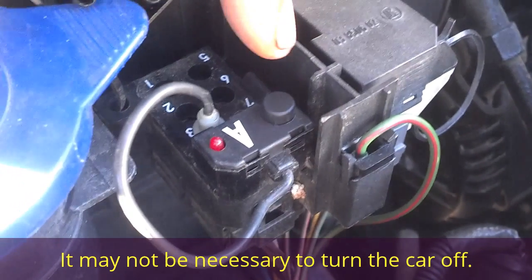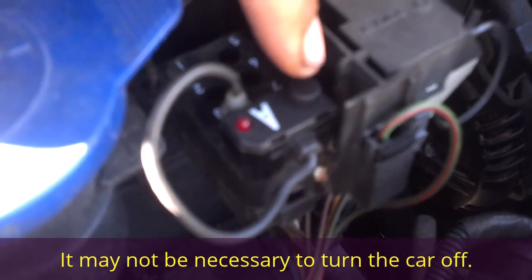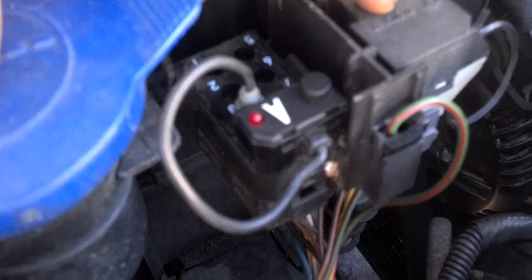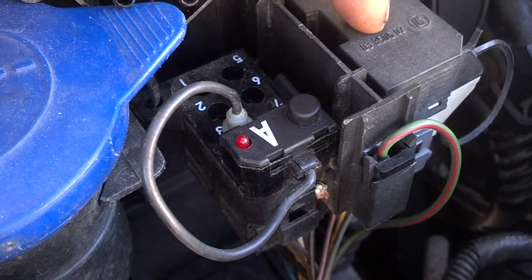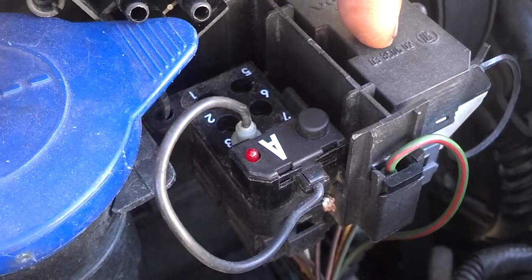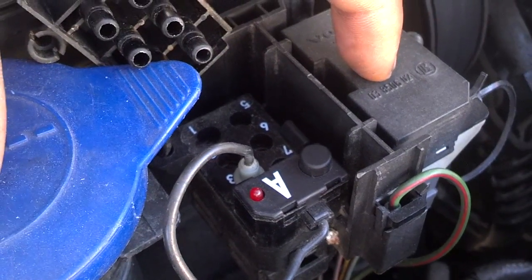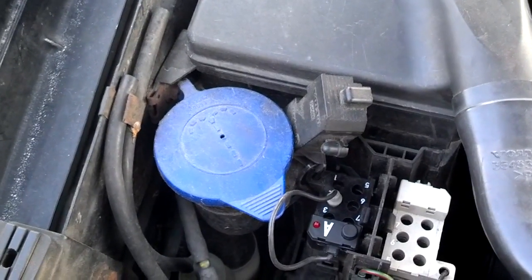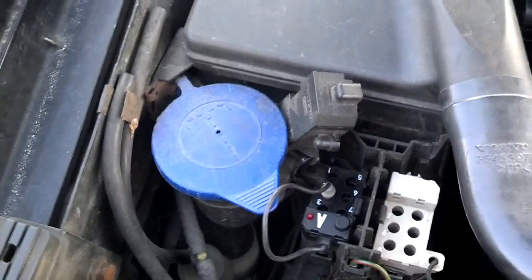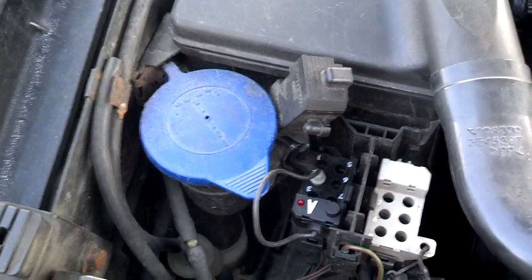I went in the car, shut it off, and turned it back on. When I push this button I should get one, one, one. Now I know that my system is clear. My check engine light should be cleared and all the codes in that system should be cleared. I can close everything up, drive the car around, and see if the light comes back.